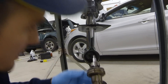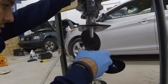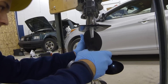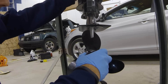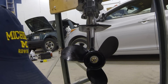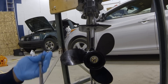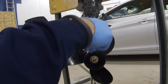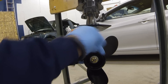We'll start putting this back together. Got all our parts together — we'll shift the motor into forward, with the cam all the way out of the way. Give this a little wiggle to help get the pinion teeth lined up with our ring gears. We'll reinstall the two screws on our seal, then shift into neutral again to help get the prop lined up. Reinstall the screws for the seal, get the seal tightened up, and then refill the lower unit with oil. Check out the linked video if you're not sure how to fill the lower unit with oil, and you're done.